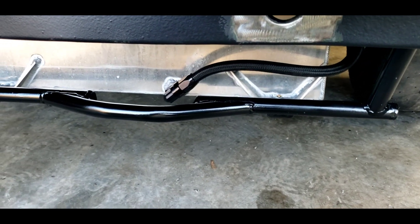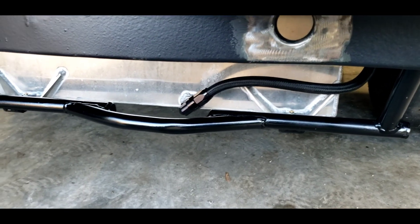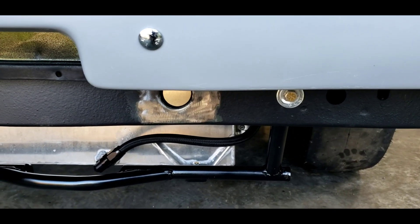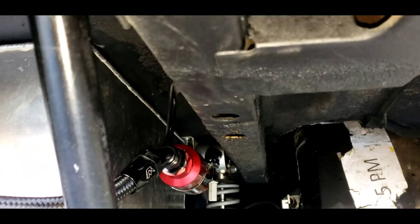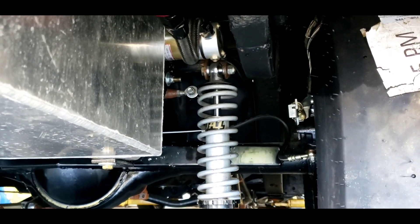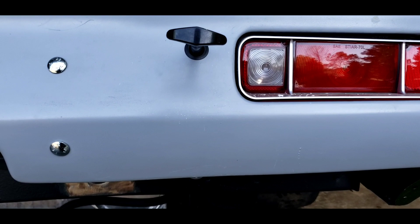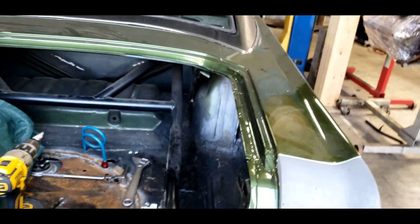There's the fuel cell and the bar I made to mount it and hold it up there and to protect the fuel cell in case it gets hit from behind in an accident. It's got a fiberglass bumper and that's not going to stop anything — it's just going to be the sheet metal doing the work. So I added that bar, and you can see the fuel filter and pump up there. I ran dash-8 line all the way up to the regulator for E85 — the extra fuel needed for E85.